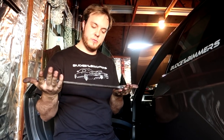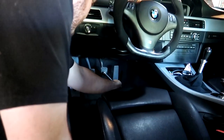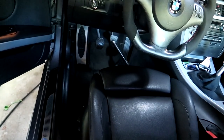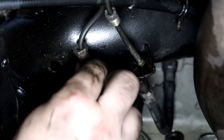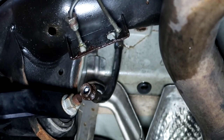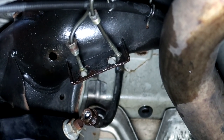I got a little trick for when you're taking out brake lines: you take something like a breaker bar and put it up against the brake pedal, then move your seat into it. What that does is it keeps the brake fluid in the lines through some kind of magic - it leaks a lot less doing that. How are they not leaking at all? Because of the brake trick. They're not leaking at all. That's ridiculous.